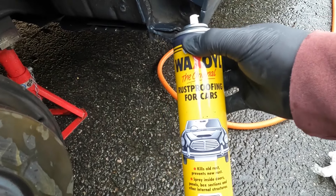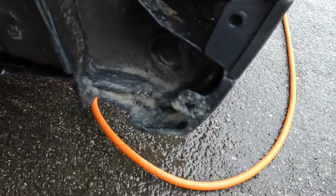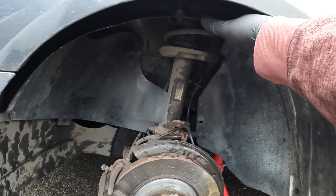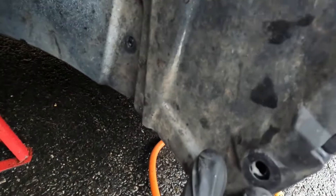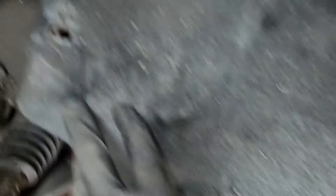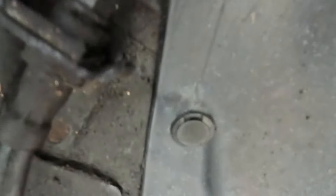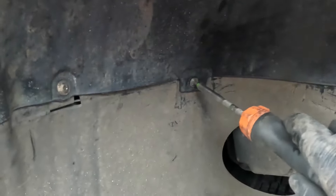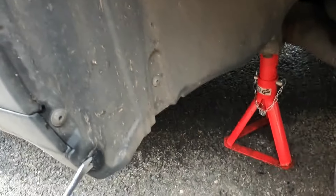I've let that dry out and I'm just going to spray a bit of rust protection in here — not going to go crazy, but there is that little bit of bare metal. The new liner is being eased into place; it's generally easier to get this edge in first and line up the screw hole before moving on to the other fixings. Everything is lined up: three at the front are tight, clip back in there, clip back in there, clip there, two screws at the back — tight — clip there and a screw up there. That's tight.